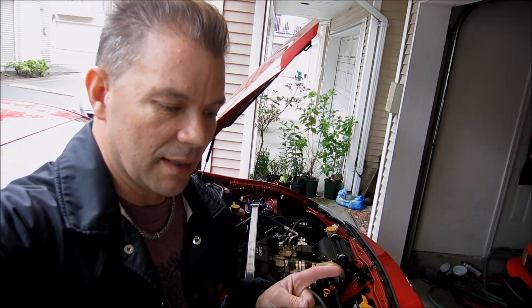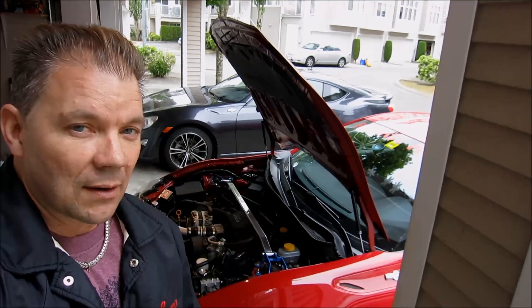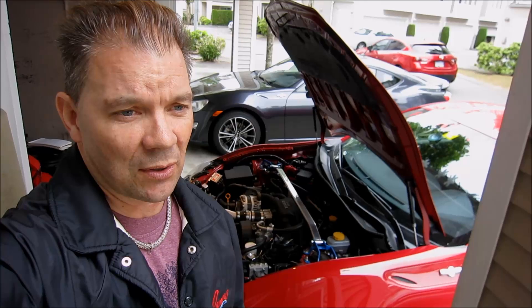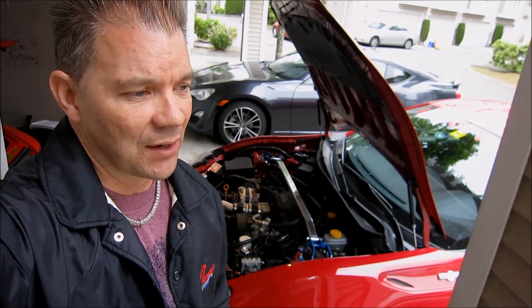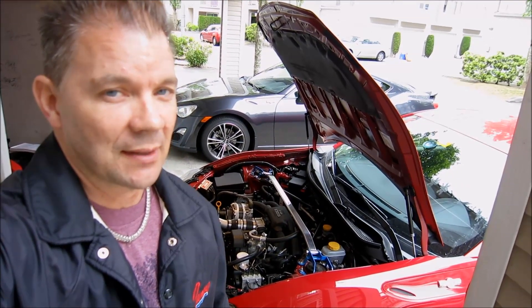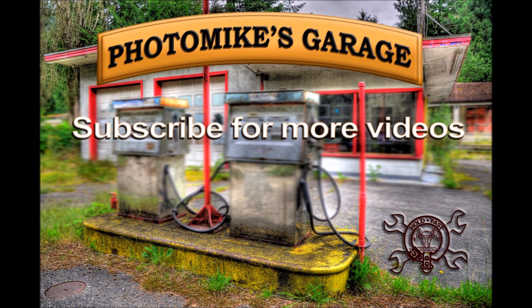So it does work. It is corrosive. I still can't recommend it to anyone else — this was just an experiment for me. It did work in this case, so try it at your own risk. Also, methylhydrate is expensive — it's more expensive than E85, over $2 a liter. But it's very convenient because it's at every Canadian Tire; you can get it everywhere. So am I going to try it again? Yes, I am. We'll continue boosting with my electric supercharger. Thanks for watching — Photo Mike's Garage. See you next time.